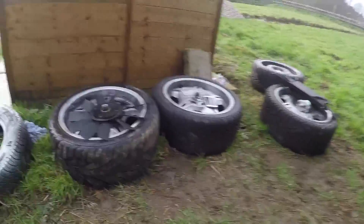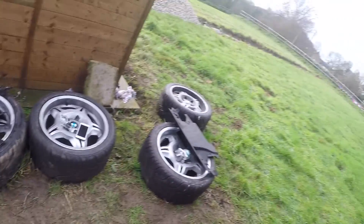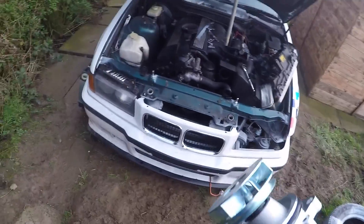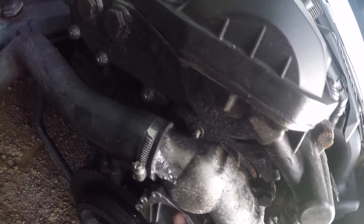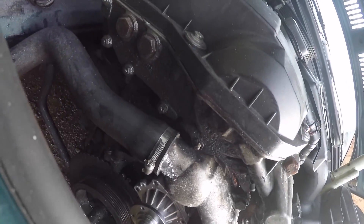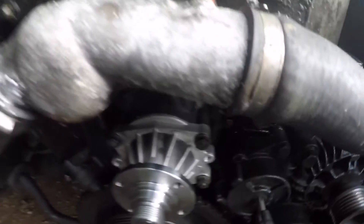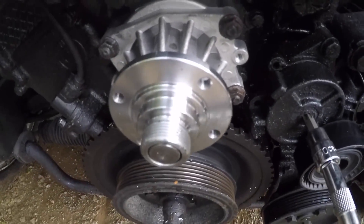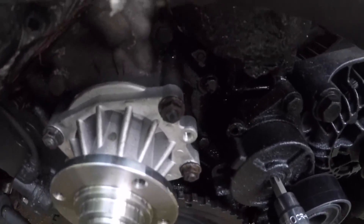You're going to get water if you can't drain the block. This one is metal, so it has been done at some point, but you can't tell until you actually get into it. Before you fit the new one, make sure it's got the o-ring, and it's a good time to clear any debris in the channel. It's obviously going to be more than one way it can go on — I got it first time. You have to give it a bit of a tap to sit so you can get the nuts on. You sort of have to put one on, push it a bit, go to the opposite side and slip that on a bit. Once it's down, I think it's 8 foot-pounds — basically until it's hand tight. Don't want to break any threads here.